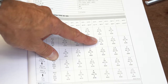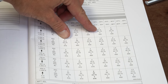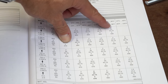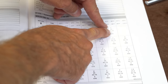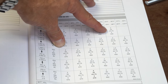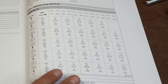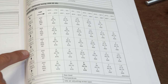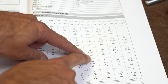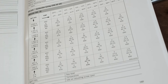I'm going to use specs from my 2018 bike as a baseline. You can look at the chart and say, 'I ride from 5,000 to 7,500 feet and it's generally 60 to 80 degrees — this is what KTM suggests.' What I've noticed over the years is you can usually go up one row and over one column, because you're accounting for elevation and temperature together. I tune my bike more along the lines of the 7,000–10,000 foot, 80–100 degree range. I think KTM makes these jetting charts conservative to cover themselves, but do this at your own risk.